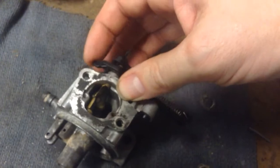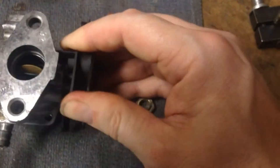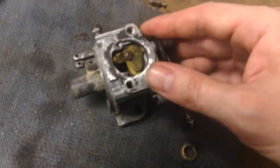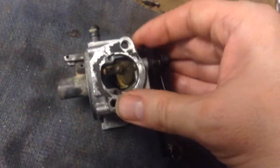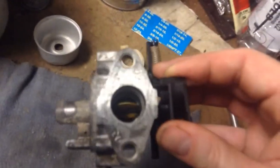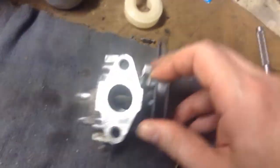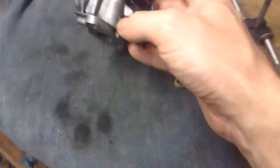Here's something interesting — there's your choke valve, still works fine. But look at the main butterfly valve: it's seized up, barely trying to move. What's the difference between the two? How come this one still works and that one doesn't? They used a brass shaft on the choke — there's some plastic on top, but the shaft itself is brass. The main throttle shaft is black plastic, and it seized up. These are very similar on a lot of small engines.